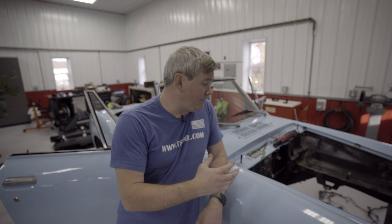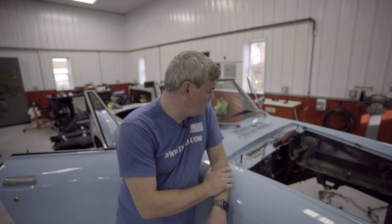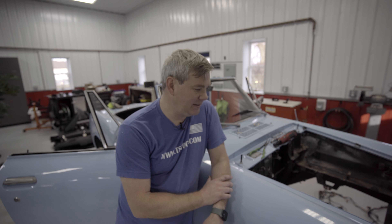That's pretty much it for the teardown. Still have a couple of brackets I need to pull out of the engine bay, get the grinder out, do that. I did get the brake master cylinder and the clutch cylinder off — we're going to change that out. I'm not sure what I'm going to use for that just yet. If you have any good ideas, comment below. I was planning on using 300ZX brakes all the way around — I've definitely got them for the front, and I was going to adapt them to the rear as well. I was probably thinking about using a 300ZX master cylinder setup, but I'm not sure. I don't know if I want to go as far as to put a Tilton pedal box in, so definitely leave a comment below if you think you've got a good idea.